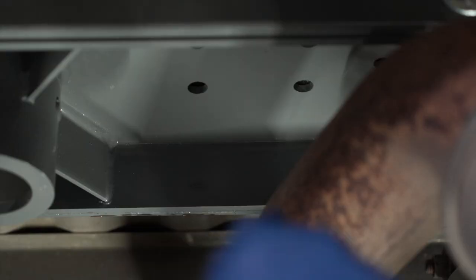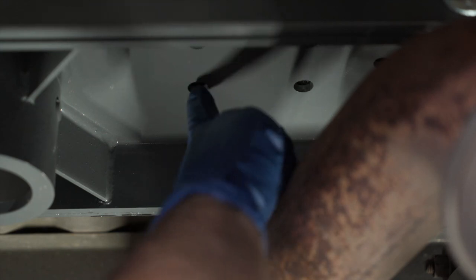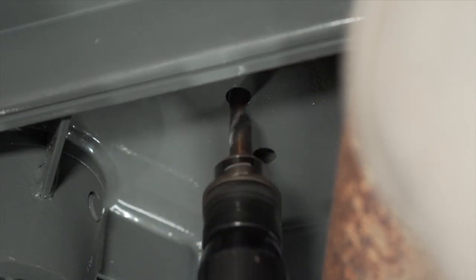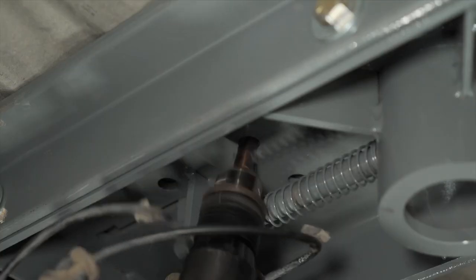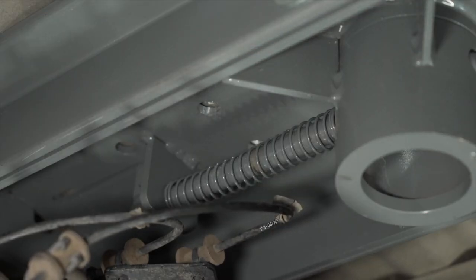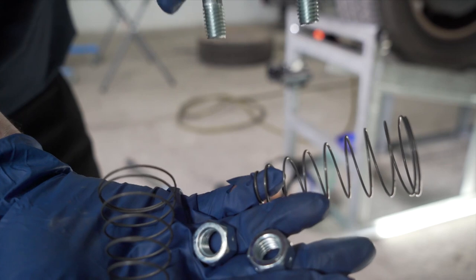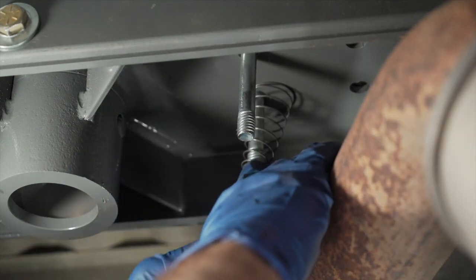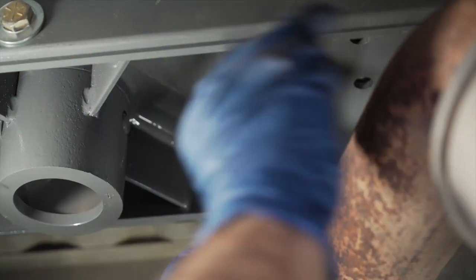You will notice there are 4 holes in the plate for our safety chain U-bolts. Choose the 2 sets that line up with a low rib in the truck bed. In this case, our inside holes line up with a lower rib and we will drill there. After you have drilled your 4 holes, you will take your 2 U-bolts, pass them from the truck bed down, apply conical springs, and then tighten down with the nuts until flush with the bolt.